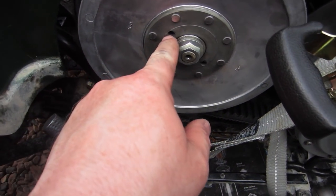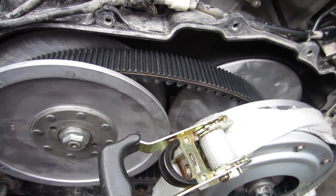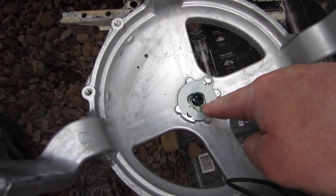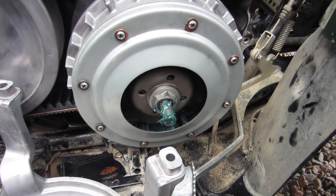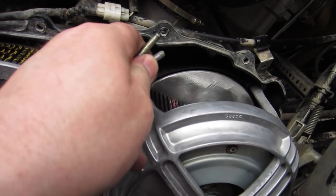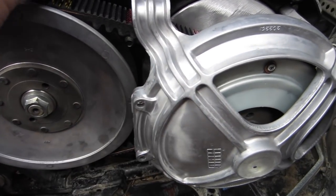Take the bolts out that you had in your back clutch holding it apart, and once I get this off I'll spin that backwards and the belt will come up. I ended up putting on a new belt — the old one I think still had lots of life left in it but we'll keep it as a spare. Also make sure you get some grease on the end of the shaft that's going to go into the little bearing bushing on the end of the carrier — keep that greased. The longer bolts are used to keep the carrier in place — one, two, three, and four — and the shorter bolts go for the cover.